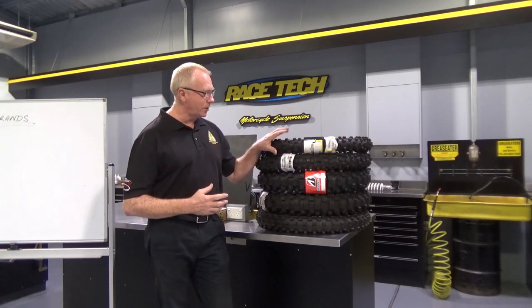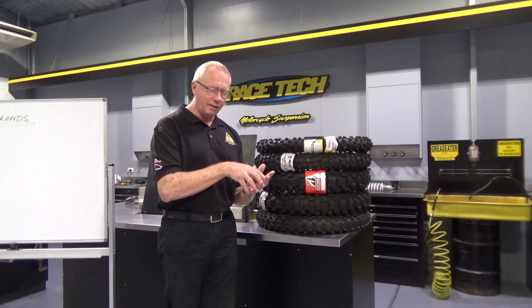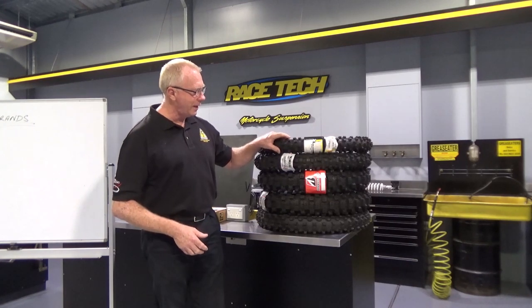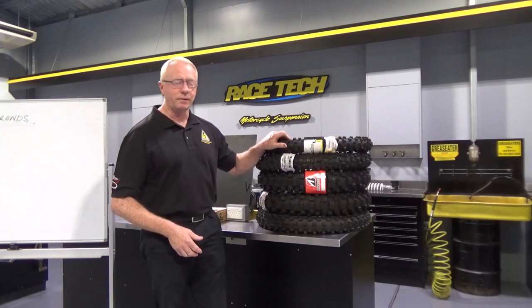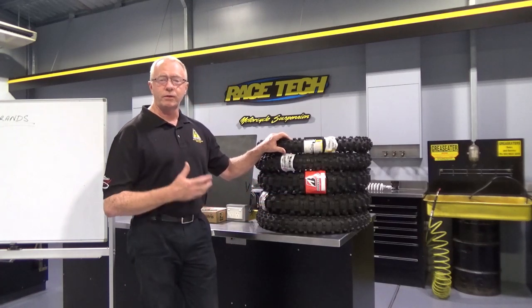It's much like a footballer's spikes. If you've got a footballer running on soft ground, the spikes are spaced far enough apart that they penetrate the ground, and they're stiff enough to claw at the ground and create grip. It's the same thing with the rubber in these tyres — they have the hardest compound possible, and they're designed to penetrate the surface in order to work.